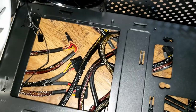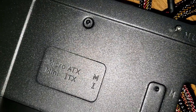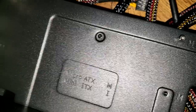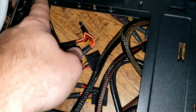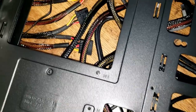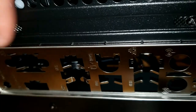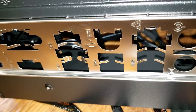We look at the bottom where it says Micro ATX / Mini ITX — it tells you where to put the standoffs. For anything with an 'M' marking, we put a standoff there. On the back, I've already installed the I/O shield that comes with the motherboard. You just press it in and it snaps right in — it's the input/output shield where your USB ports and audio jacks will be.